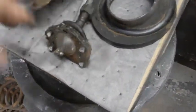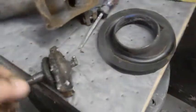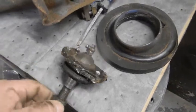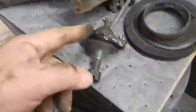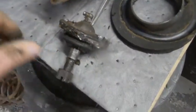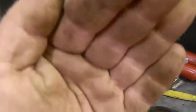The Galant outside is completely opposite - the lower ball joint sits inverted and the load is on the cup, and they pop out. Very bad. I'm not going to say it isn't Mitsu's fault but a lot of people did it that way. I guess they figured if the ball joint was good this way it's got to be good that way, but it's a fraction of the surface area. I remember Fords popping too - Mustang ones, five years old, popping out in the front, and then the tire just goes to the ground.